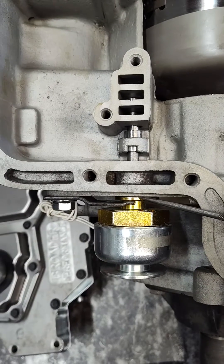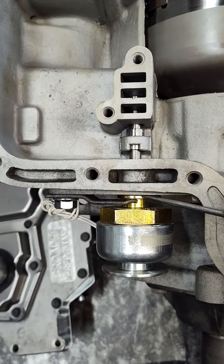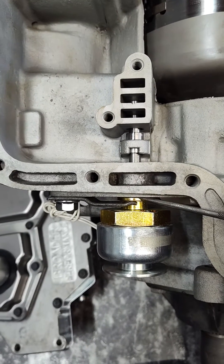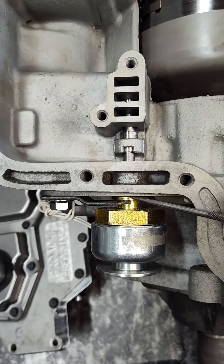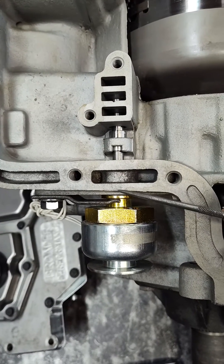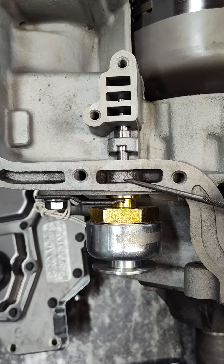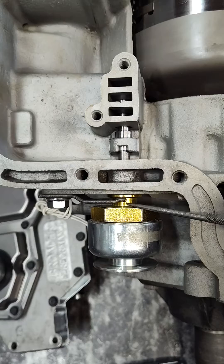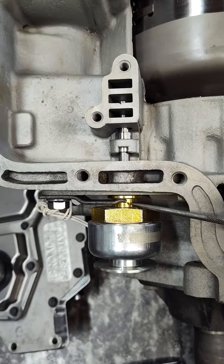It's not a very common scenario — it's like a ribbed 385 series case, that would be like a 1971 or '72, right in the changeover period. For some reason they only drilled this halfway, and these solenoids are not designed for that. Just an oddball thing you may run into.